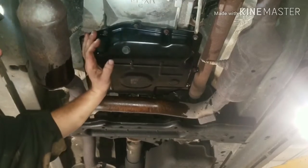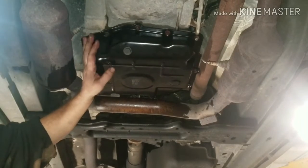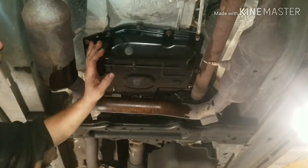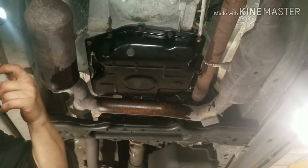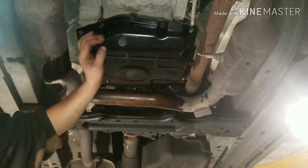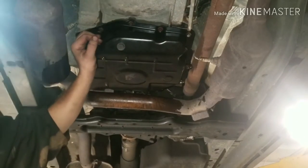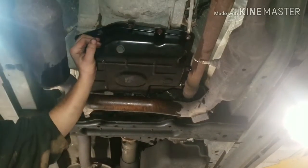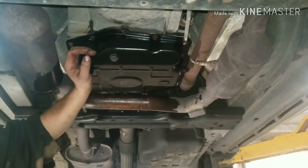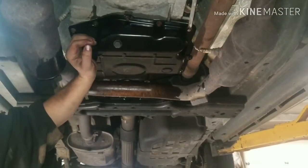Now, with me, I've got an actual service dipstick for the Chrysler transmissions, because you'll notice that the transmission dipstick tube is blocked off with a service plug. And if you're lucky, you can go out to your local junkyard, like we have around here, Weller Self-Serve, and find yourself a dipstick that's in a Jeep Liberty or a Cherokee that has the 3.7 or 4.7 liter V6 and V8. The dipsticks are the same. So if you find one of those, you can actually replace that service port with the actual dipstick, or just keep it in your garage. And you fill it up as well.